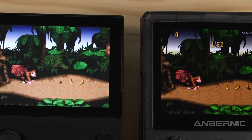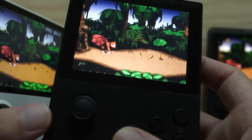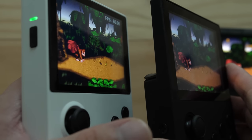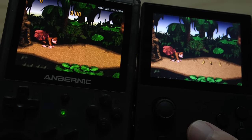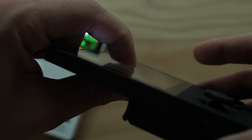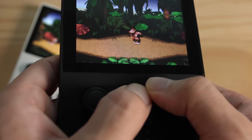The lack of OCA is going to mean that you will be able to see a rather large gap between the front screen and the IPS under it. It is also possible for dust to get inside the gap during use or from the factory, but the high brightness value and a good color temperature help balance out these negatives. The front screen is unfortunately not glass, but the retail version has a glass 2.5D screen protector applied to it.